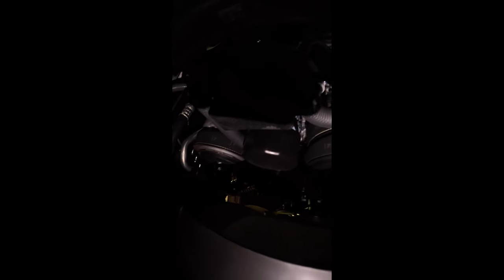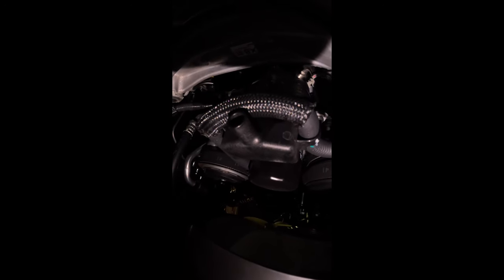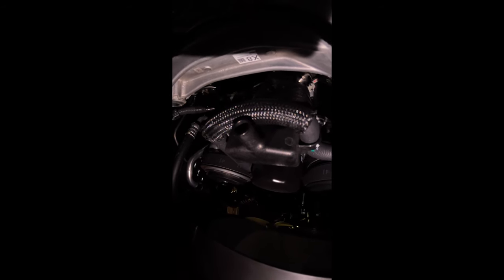Up underneath the truck, I'm going to move this skid plate out of the way so we can get to the oil filter by just undoing two bolts with a 12 millimeter socket. Right above this plastic piece is where you're going to put your drain hose - that 5/8 hose. And right above that is your oil filter. It'll drain through that plastic port where I'm going to insert the hose.